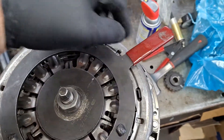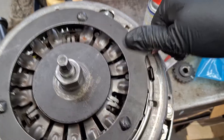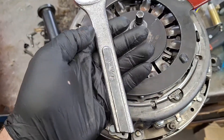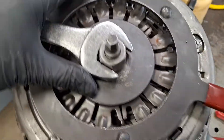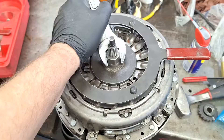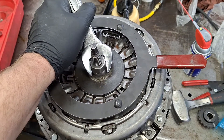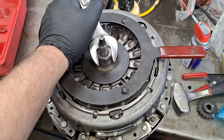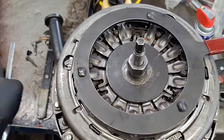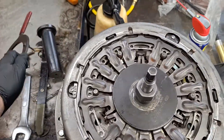I had to just pop the handle with a hammer just a little bit. It didn't take much, but as you can see now, hold that clockwise all the way like this, and then run that nut down with your other hand all the way down. I do have a one and one sixteenths that I've cut down just to make it easier to maneuver. For camera demonstration purposes, I am holding the red handled tool right now with my left hand in the release position — if I let go, it's going to release. You want to keep holding that tool to the clockwise position, and I have this nut run down flush.